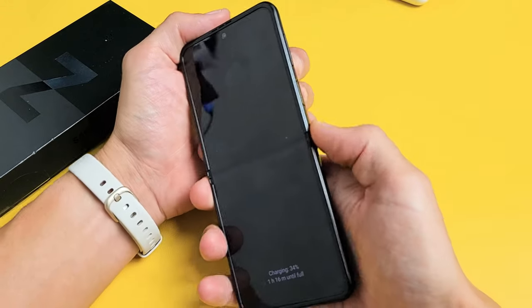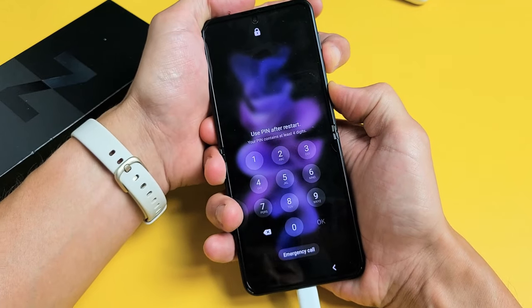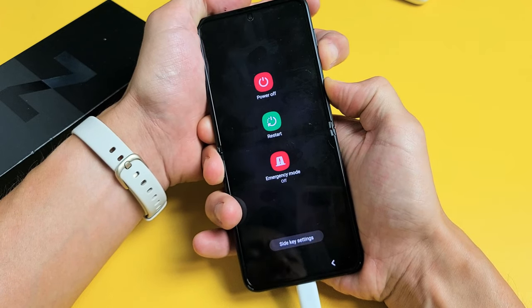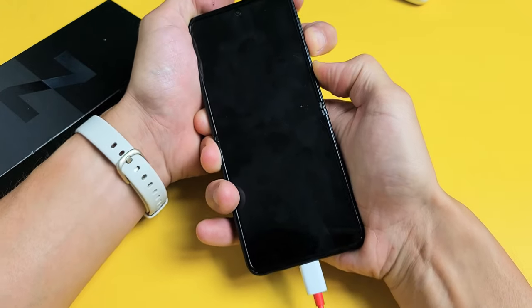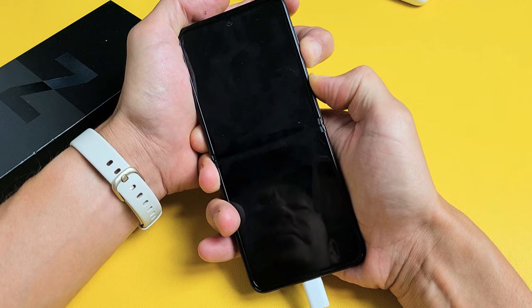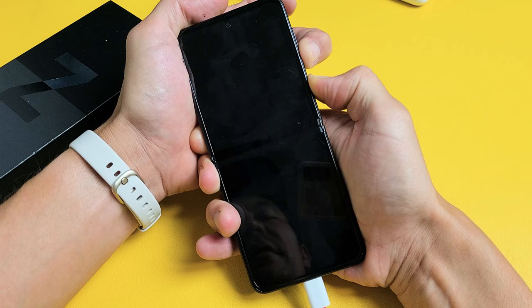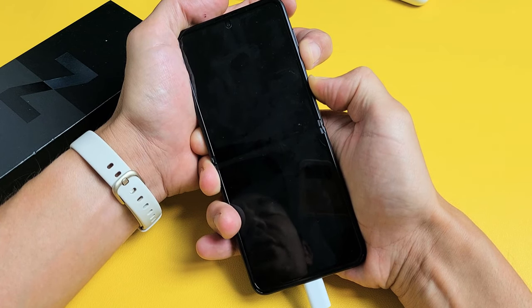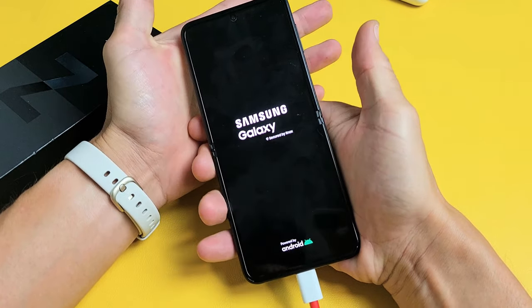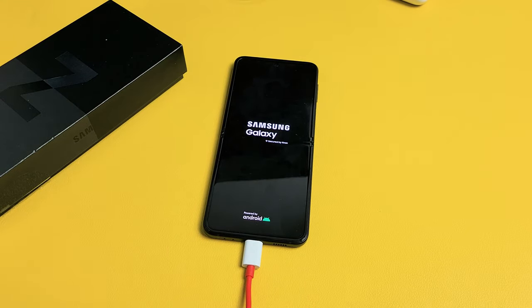After 10 seconds, we're going to do the same thing while it's plugged in. Remember, volume down, power. Press and hold both buttons. Do not let go until we see the Samsung logo. Pretend my screen is totally black — I have no idea what's going on. I just know I have it plugged in, it should be charging, and I'm holding down both buttons waiting for that Samsung logo to appear. I felt the vibrate — Samsung logo. Go ahead and let go, and hopefully now you are up and running. If not, we're going to go to the third possible solution.